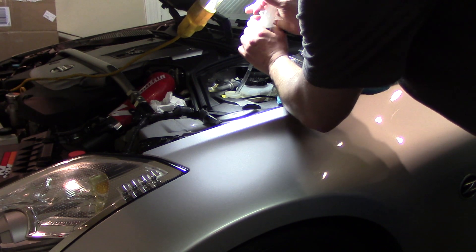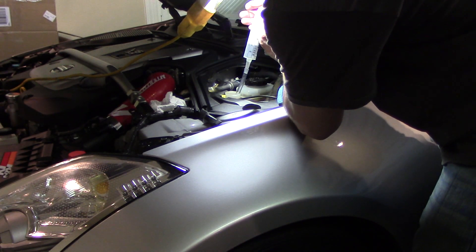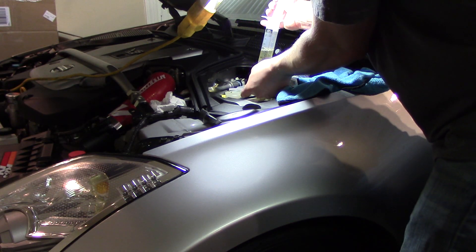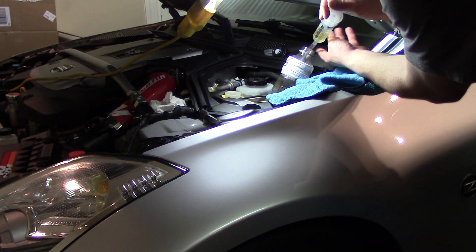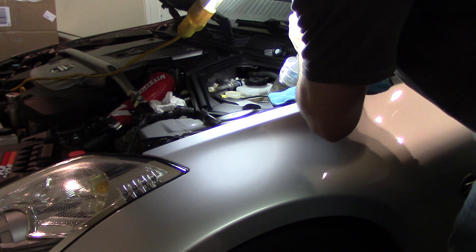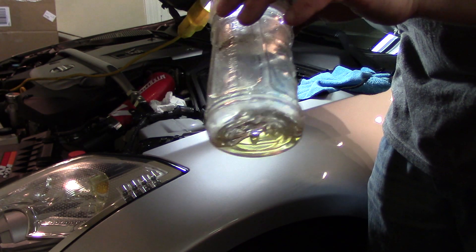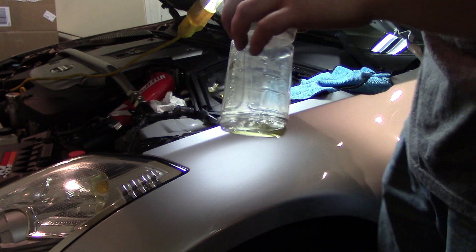I've personally done that myself and seen it. Is this as good as going down there and bleeding out your whole clutch system? No. But is it a lot easier and quicker? Yes. This reservoir holds very little fluid. I pull it out leaving enough to not cause air, bend the tube to hold it so it doesn't drain, then move it over the container and push it in. I do it twice to make sure I get it all out.